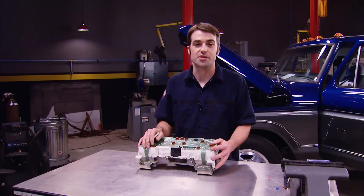Another option is this rear window defroster repair kit. This is a conductive liquid that brushes on, and when it dries it acts very similar to a wire. A little fine line tape will keep you from painting outside the lines. Now this spot does have continuity, but it's clearly been damaged, so we're just going to reinforce it. First, get rid of the plastic, get down to the copper. We just want to isolate this trace from the others. The other traces are laminated in plastic and somewhat protected, but I want to keep the repair confined to this area. Give it a few coats — a little extra material will make sure the repair can handle the current load.